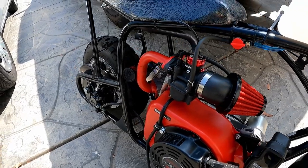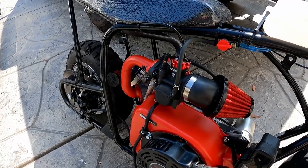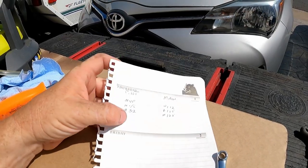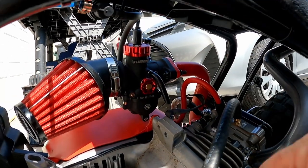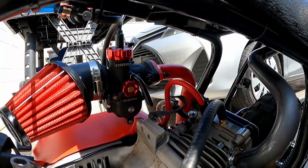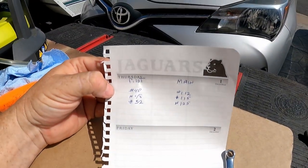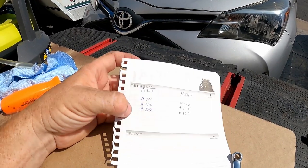I've got it mounted back on again — probably for the third or fourth time. What I ended up with was a 52 pilot jet and a 125 main jet, with two turns on the fuel screw — turned in gently until it bottomed out, then two full turns out. The idle adjustment I set to where I like the idle. With that said, let's take it for a ride and show the difference now that we've made these changes.